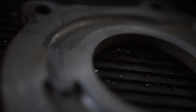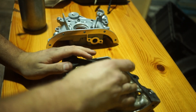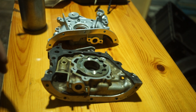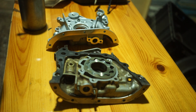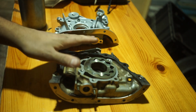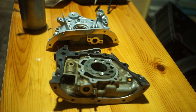You can also see wear in the gears, but it's not as prevalent as in the back plate itself. The gears have some scratches which are noticeable visually, but not really noticeable with your finger. With the back plate, there were deep scratches that were actually noticeable with your finger and fingernail. You could get that plate resurfaced and the gears resurfaced too, but you would also have to machine down the housing to the proper size, and that's going to cost a lot of money compared to a new pump.